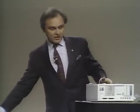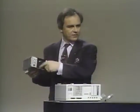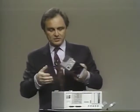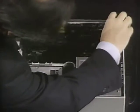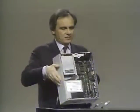As the Volkswagen ads say, so now we have the storage subsystem. This is the power module with the air motion device, which we made even quieter. Ventilation is from front to back to keep the noise out in the back, and the power supply module drops in place. This is the NuBus 8-bit video card. That drops in here. And we have a fully assembled Macintosh IIcx here.